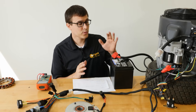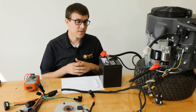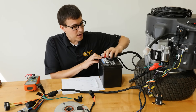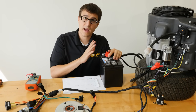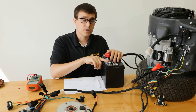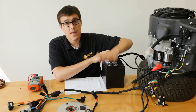Because we're dealing with a live system and the engine could potentially start or run, you want to be sure all the shields are in place, that you're in a safe place relative to the machine, and that you're generally aware of the mechanical systems. If you're going to disconnect the battery, you don't want to take the positive off first. Disconnect your ground first so that you have an open circuit — a wrench won't arc. When you put it back on, put the positive first and then the ground.